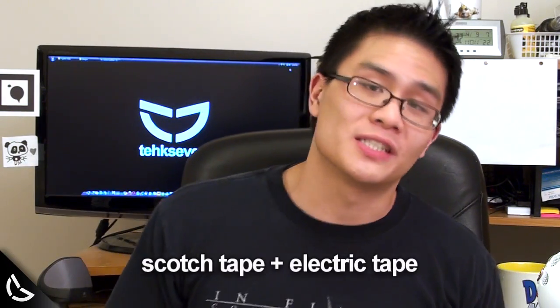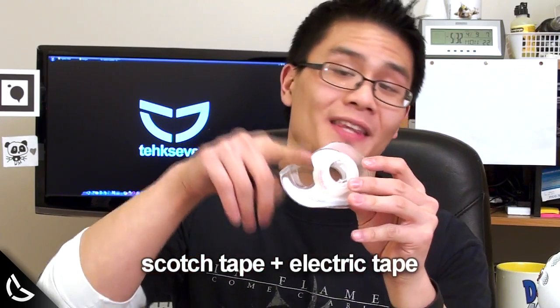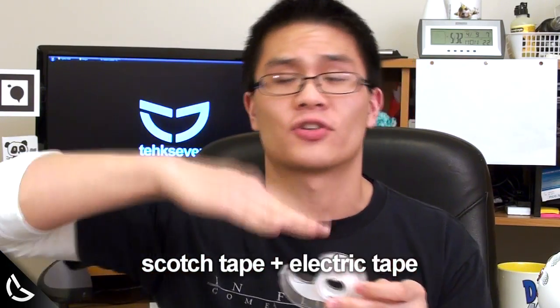After doing this, if the N900 slider still isn't tight enough for you, add another layer of tape. If that's too much, then try combining it with Scotch tape, which is thinner, so have Scotch tape on the bottom and electrical tape on top. Kinda silly that you have to use tape to fix a $500+ device, but oh well.